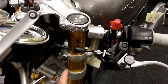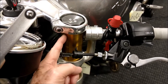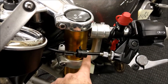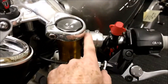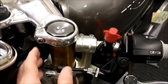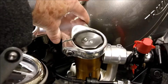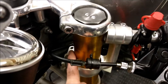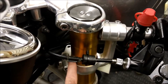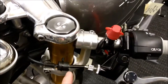The clip-on slides all the way up to here. So for me to have this fit the fairing I have to move them down, and I have to be able to get it past this — so this won't slide past this. What I had to do is remove the top yoke triple clamp, or I jacked up the bike and dropped the fork tubes down low enough so I could get these below that.